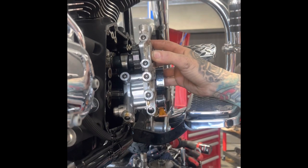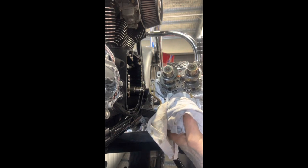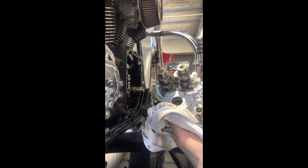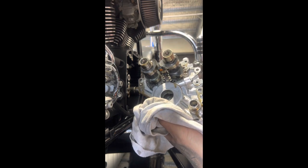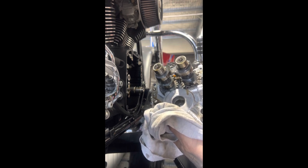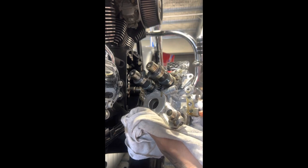Some of the checks that go on — I'll just let this drain. I know this is going to be a bit hard with one hand, I'll film as best I can. So what we've got to look for here: your oil pump feed — there's an O-ring that will be recessed into the motor there, and then we've got a couple that seal up against the oil pump itself that produce your oil feed. Going back to the tank, this being a softail, we have got a couple of things to keep an eye on here.